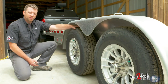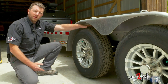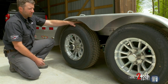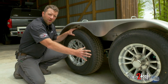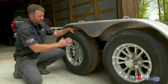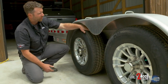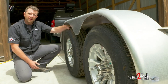One thing we see a lot of in the shop is irregular tire wear. If your trailer is not level or you're not loading it properly, one axle or the other is going to carry more load than the opposite axle. So if you're wearing out two sets of front tires for every set of your rear, you may want to look at your loading and how level your trailer is. The tires themselves will tell you the story — if they're wearing irregularly or have some chopping versus the rear set, take a look at your trailer setup.